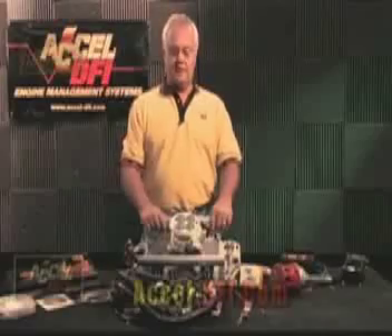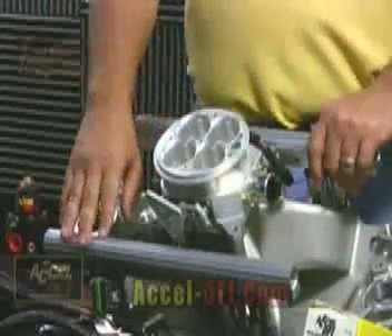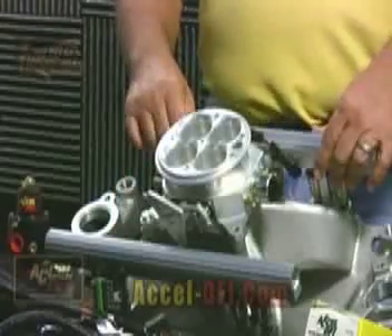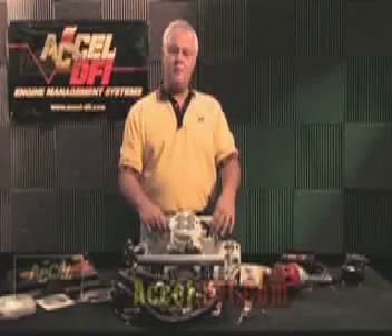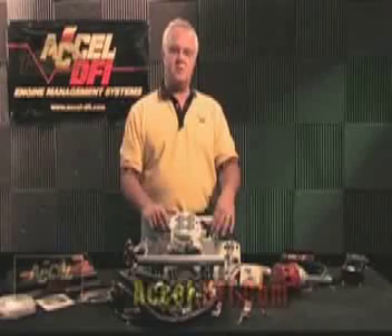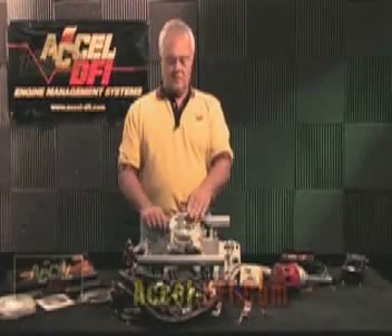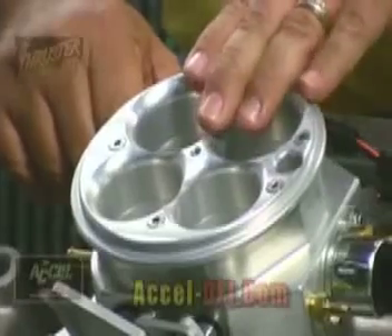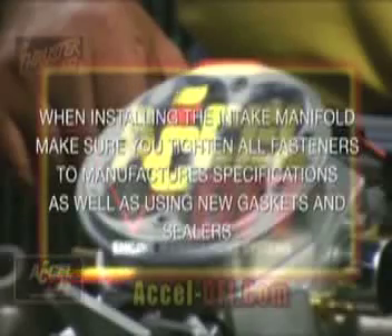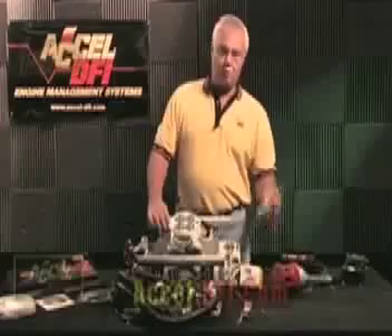When you order these kits — this kit is for a small-block Chevrolet; other kits are available for big-block Chevrolet, 302 and 351 Windsor Ford, and other small-block Fords — what you'll get is a setup just like this. It has the TPS already on it, it has the IAC already on it. It will come somewhat assembled, just as you see it here, with any size injector that is good for your application. This one, in particular, has 30-pound-per-hour injectors. You can order anything down to 21 or 24, or you can go up to 160 depending on your application — if it's blown, or if it's a large cubic inch displacement application. You also have the option of substituting different size throttle bodies. This, in fact, is a 1,000 CFM throttle body. They also offer a 1,350 and a 1,550 CFM throttle body.